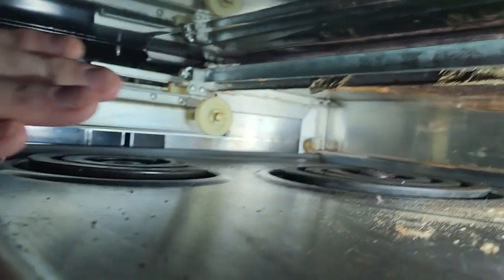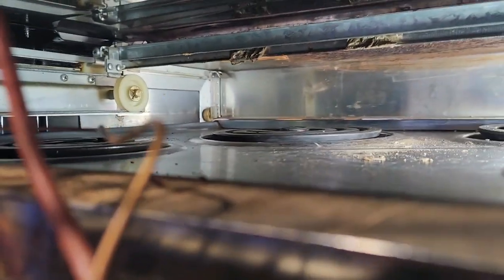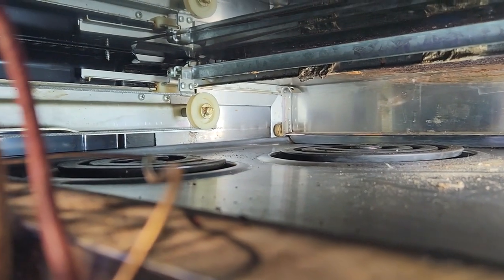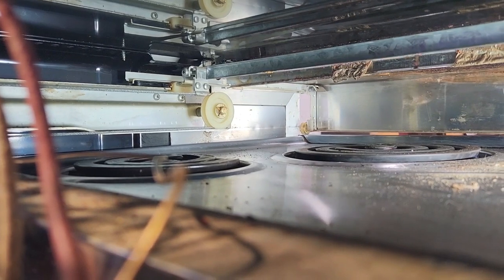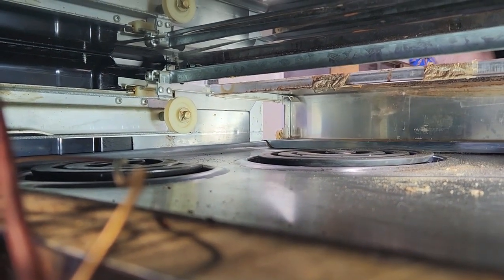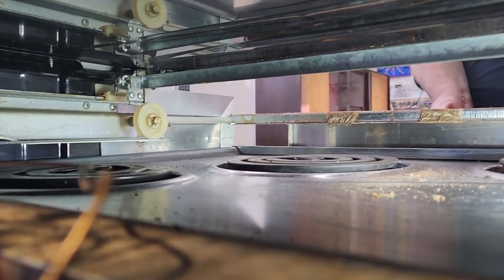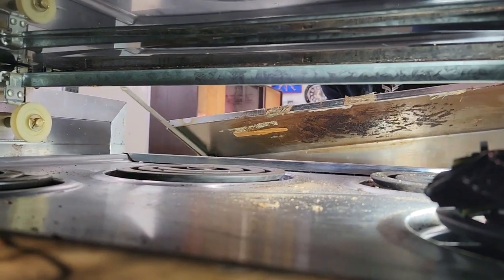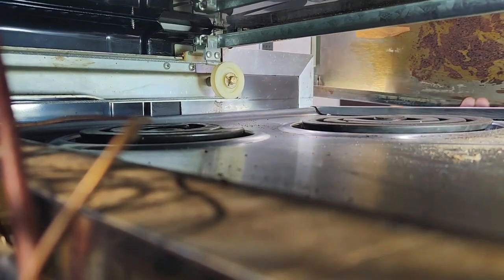But now, if you keep filming, I'll go and pull the drawer out, and you can film on the left there and see. I'm going to go ahead and pull the drawer out. Ready? See how that works? Can you see those catches right there? Mm-hmm. See how they're kind of caught? So just lift up on those and pull out. And remember, you've got your spring as well back there that you'll need to attach to your drawer.